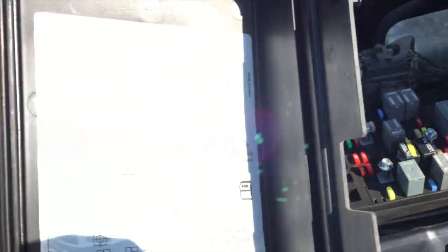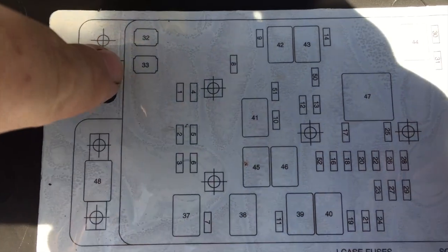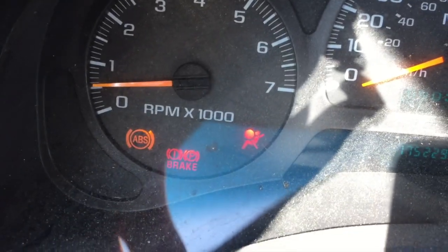So I may just try pulling out the ABS fuse and then run around the parking lot a little bit and see what happens. I'm under the hood and I just pulled the cover off the fuse panel. The ABS is fuse number 33, right there. Obviously pulling this fuse is going to trip the ABS and brake lights. Let's just drive around the parking lot real quick — I'm going to go ahead and hit the brakes. Okay, it's not doing it. Obviously it's not going to because we pulled the fuse and so there's no continuity.